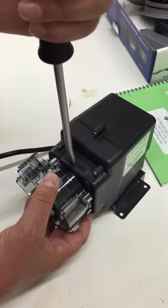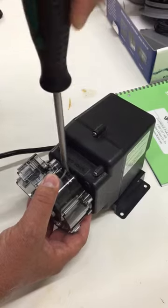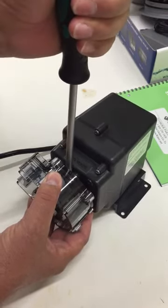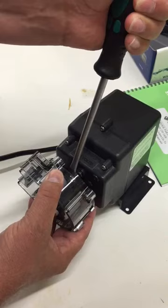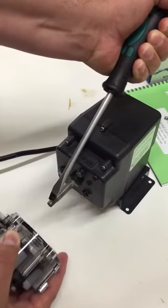By taking a flat blade screwdriver, you can stick that behind the tube housing, get it as close to the shaft as possible, and then put gentle pressure in reverse towards the motor housing so that you're putting your pressure on the center of the tube housing, and you should be able to release the roller assembly that way.